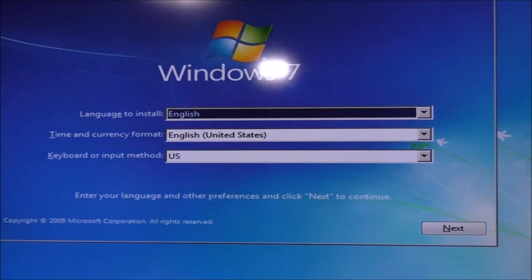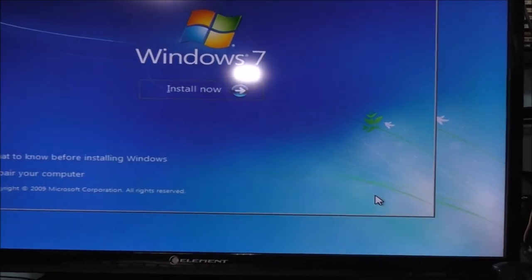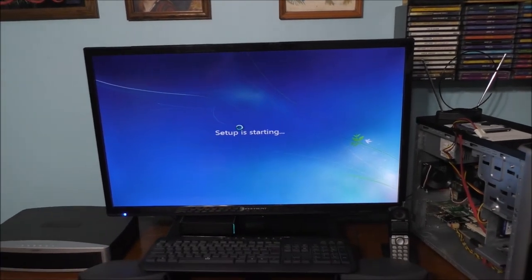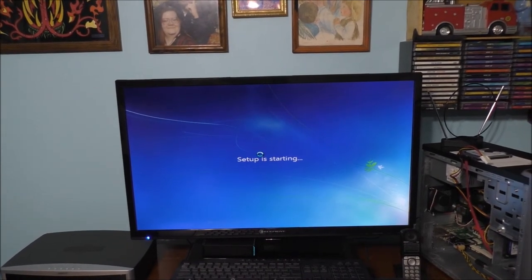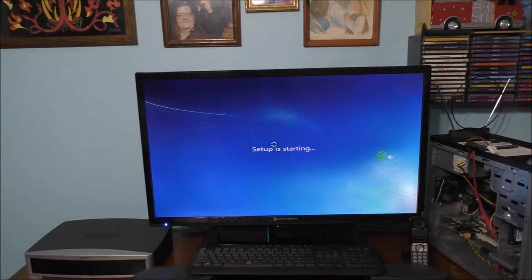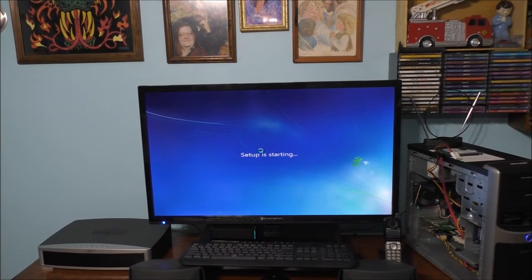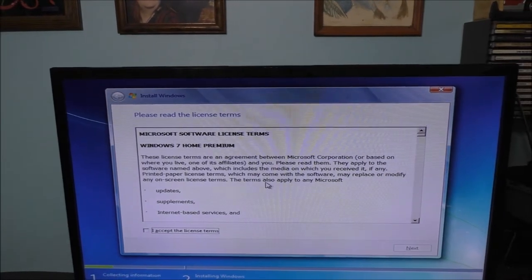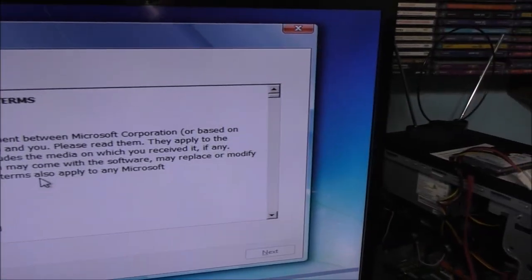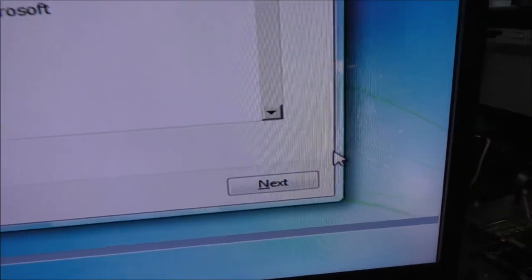You choose whatever language you want. I am in the United States, so I am going to choose English. Hit the install button. Now, that's going to prepare the settings for the drivers and everything. You still might have to download the actual drivers for your motherboard afterwards. Reinstalling Windows might actually help you get a much faster computer. Now here's the license agreement terms and conditions — check the checkbox and hit Next.